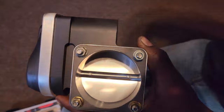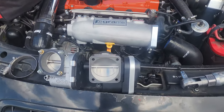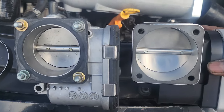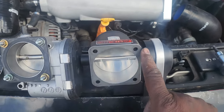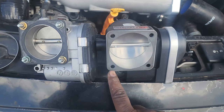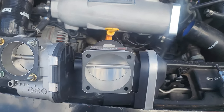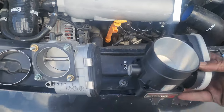I just wanted to show a comparison between the two throttle bodies before installing this one. I put a little bit of sealant on the gasket, just on the four edges, just a little bit to hold it in place because I trimmed it so close — it wouldn't be misaligned when installed because it will move a little bit if you don't.